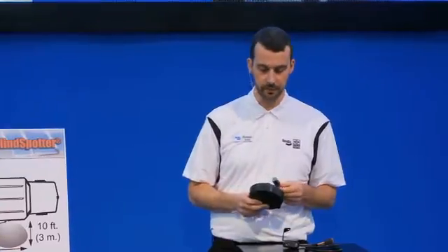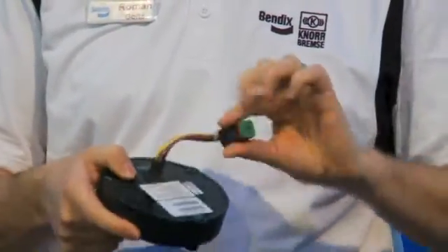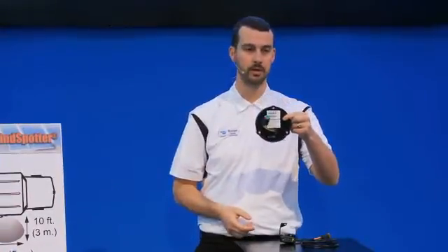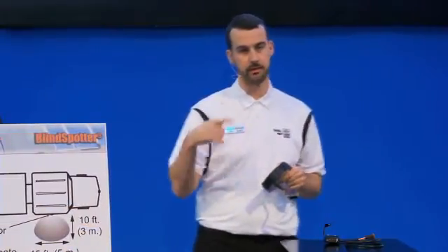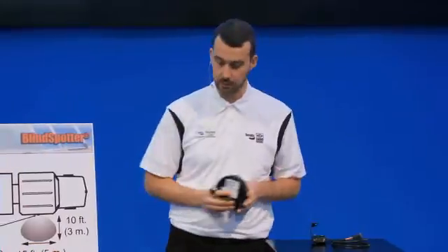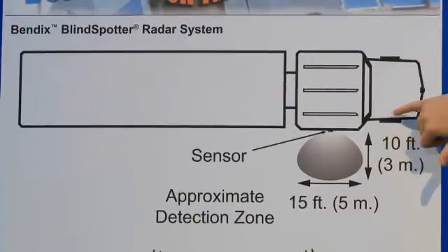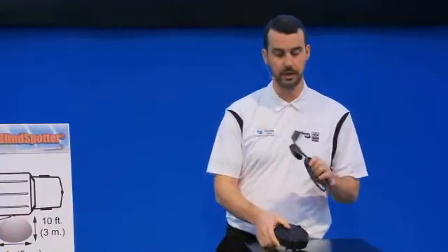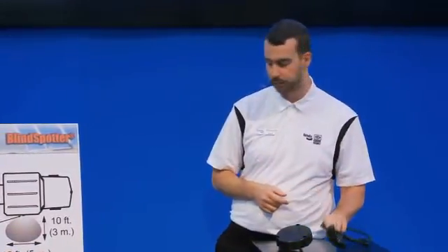The harnessing is very simple. It goes in through a J1939 harness — that's for diagnostic purposes. We also have a power hookup on the back, three mounting points, comes with mounting bolts and the necessary bracketry. You pick the spot on the side of the truck, and depending on the bracket or cutout already provided, you place the sensor there. The wiring harness goes on the inside, underneath the floor, and comes up to the A-pillar where it connects to the display. It's a standalone system, but you are also connected into J1939. Anyone can really perform this installation — it doesn't take great technical knowledge.